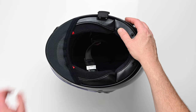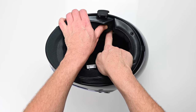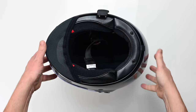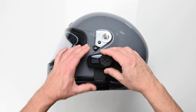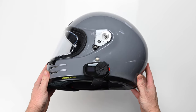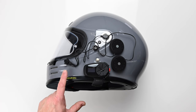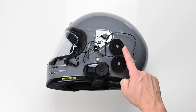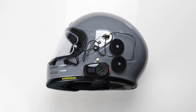One area that makes this helmet easier to fit comms than some others is the fact that it's got a split neck collar, so you've got a nice slot handily placed to run the cables through. I always find it's easier to start routing the cables with the unit mounted, so click that into place and grab the main wiring harness out of the box — you have the plug that plugs into the unit itself, the two HD speakers, and then another lead for the microphone.